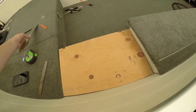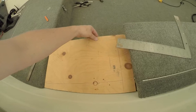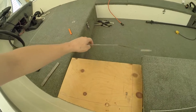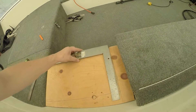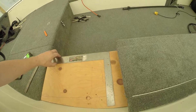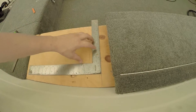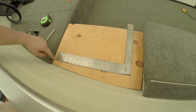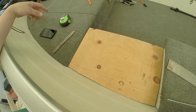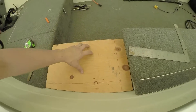It's pretty easy to do that. You just cut out your piece to get the general shape and square it up in there. This is the edge of the plywood, so it's square. Just take a square, get yourself a line down here, and then off of this line, just mark out your next line, and then go to the saw and cut those two lines out — that'll give me my lid.